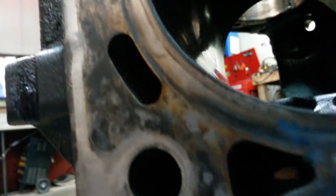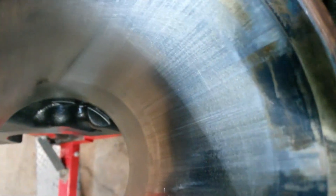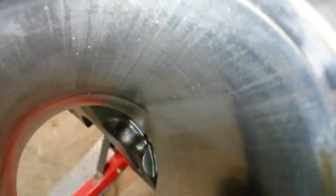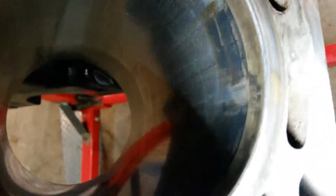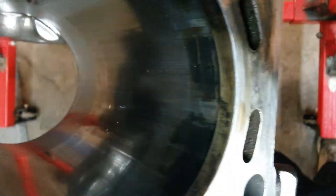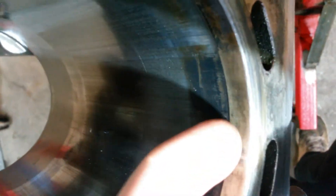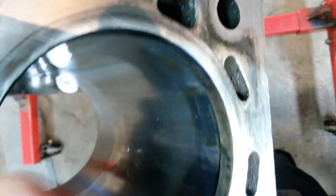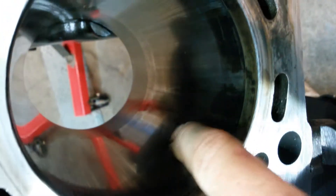Back to the black water engine here. Here is the number seven cylinder. You can see where the ring just starts scraping away at the cylinder wall. You can kind of see the honing down as you get further in there. When you get up here towards the lip, you can see there's maybe fifteen thousandths of a lip all the way around. There's a nice ridge right up in here.